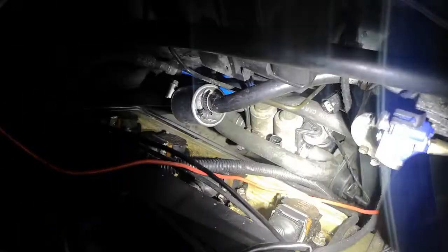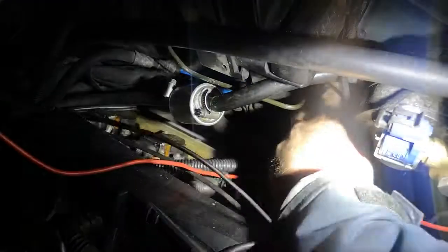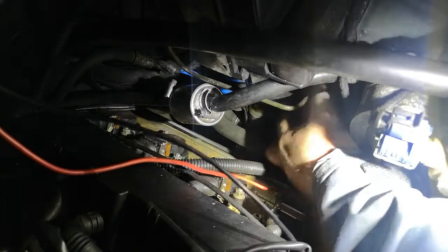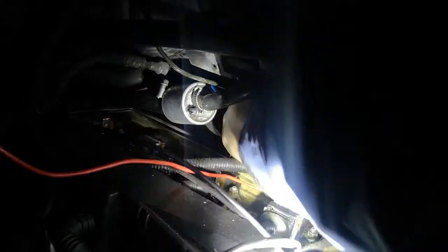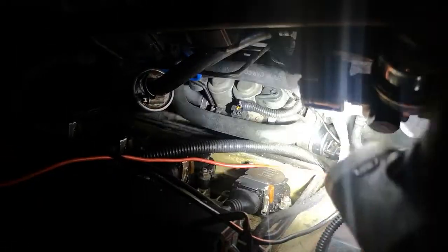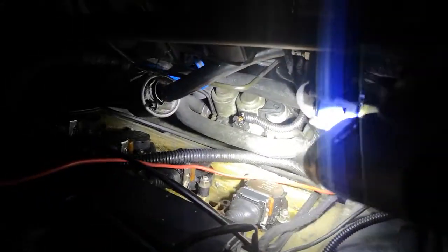And that's back in, so that's your heater valve back in, all nice and tight, and it just sits on those rubber bungs either side, and then we just reconnect the electrical connector. Back into there. So we've got the connector down there into the pump, which you can see all the pipes are on there, pipes are on the heater valve, and everything's connected up and snapped together. Everything's as it should be.